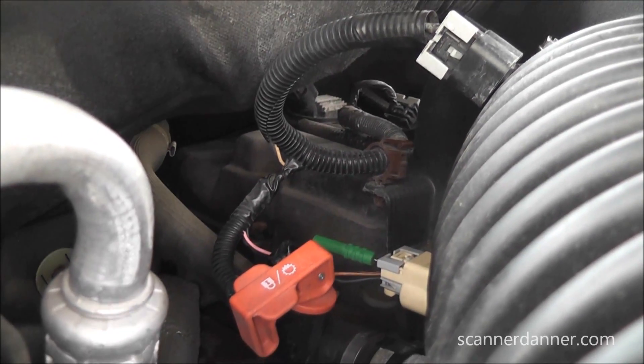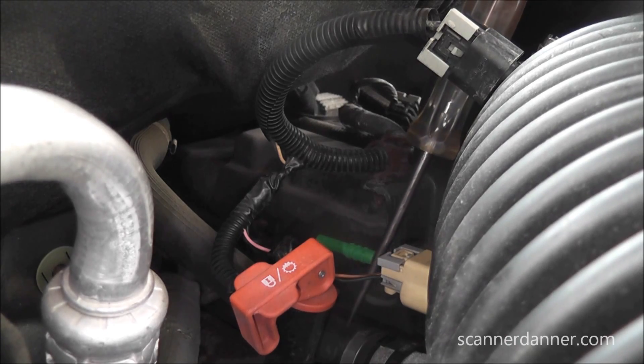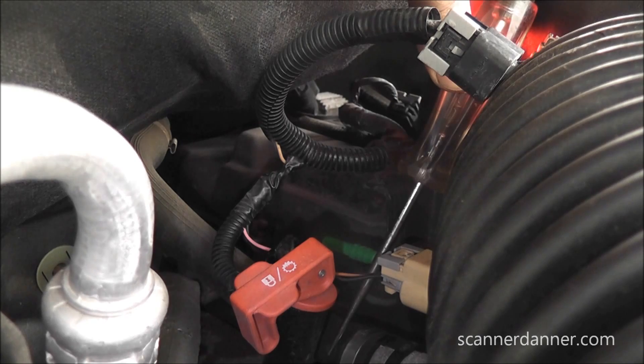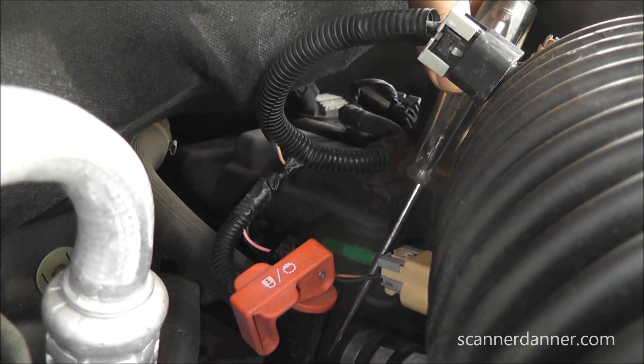Test light going to ground - checking my light. I'm resting the probe against the pin and going to reach over and turn this on for a loaded test. You can see the red glow there. Again - same power feed that's on the pump circuit. The solenoid is plugged in. I'm using a test light not a voltmeter, but I'm still doing a loaded circuit test. If it can light my light and control the solenoid at the same time, trust me there's no voltage drop problem on that feed wire.